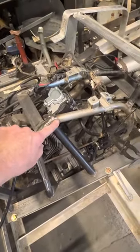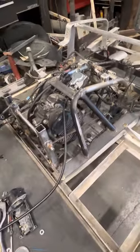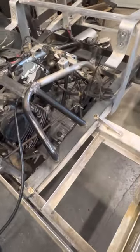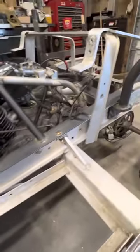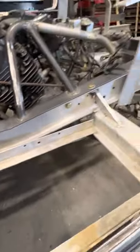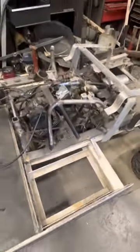Here, I chopped the original frame. I put these down on both sides to support the old frame and get the engine really well mounted in the cart frame. I made a steel subframe, and basically six bolts on each side securely mounts it into the Club Car frame.